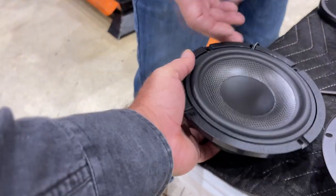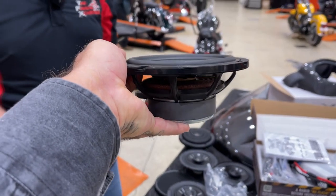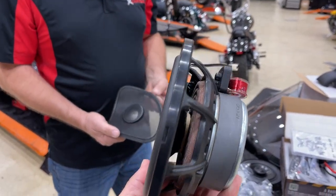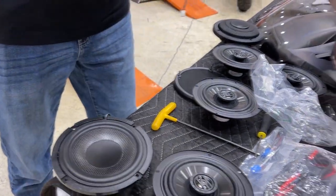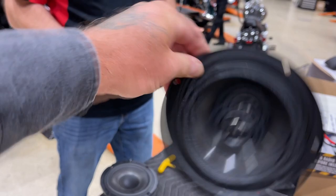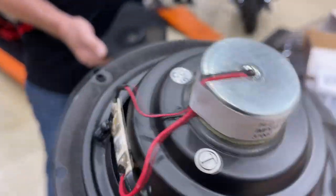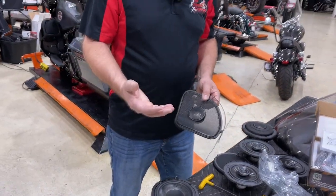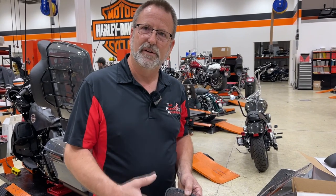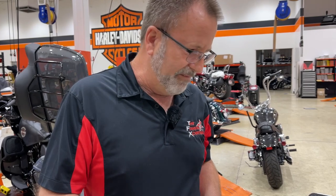It's heavy — that's crazy the amount of difference in the weight. It's that magnet, isn't it? Yep. This is motorcycle audio. It's made for a motorcycle — it's not car audio that we're putting into a motorcycle. It's made to have a lower draw from the amp so you don't tax your charging system. Guys will put 1,000-watt amps that belong in cars into a bike — they can't handle that.